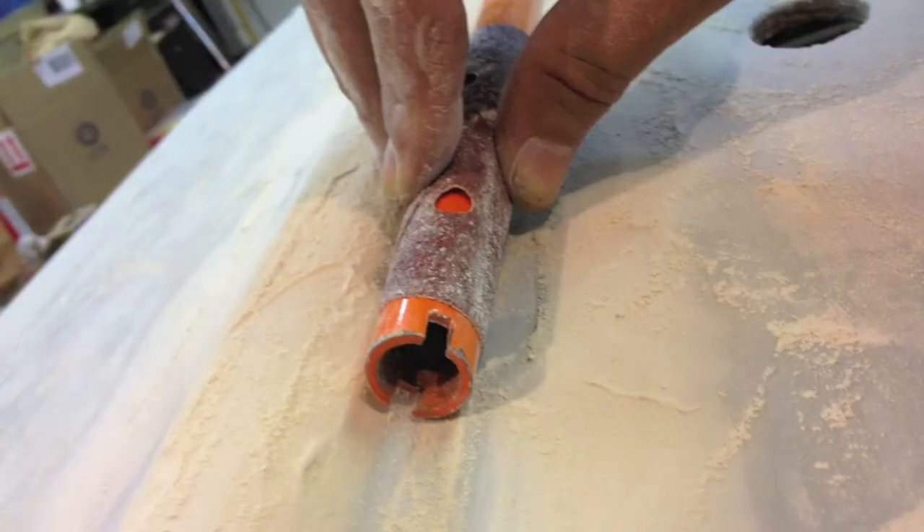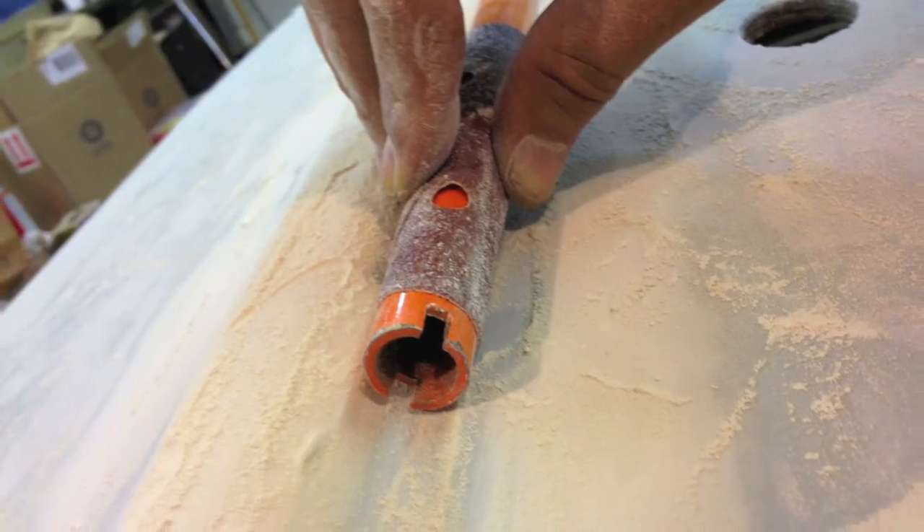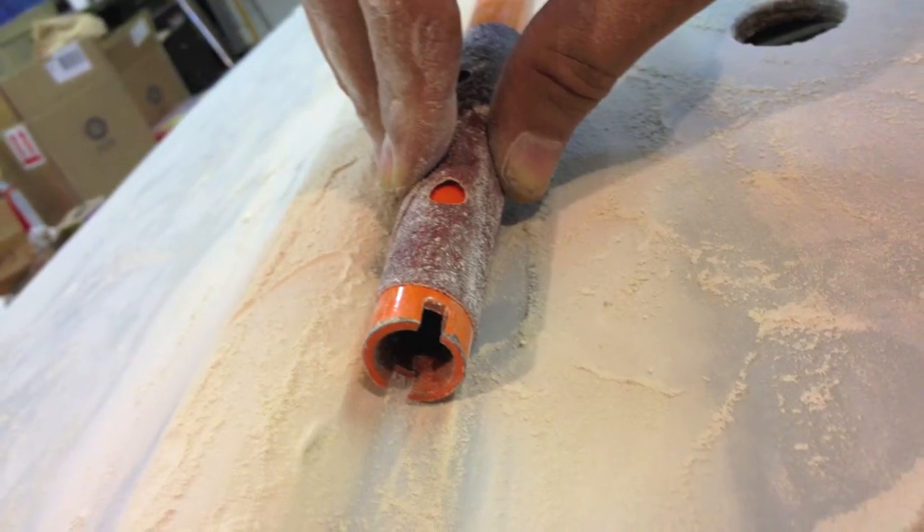Here it is faired and getting close to completed — it still needed to be leveled. At this point I didn't have a dowel to run down the side to get that curve on the side of the keel, but luckily I had a jack handle that was just the right curve. Here's a picture of me rolling some sandpaper around the jack handle to make that inside curve.